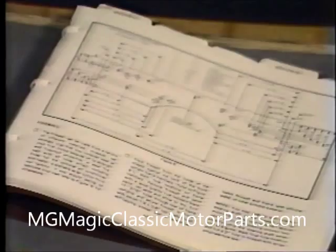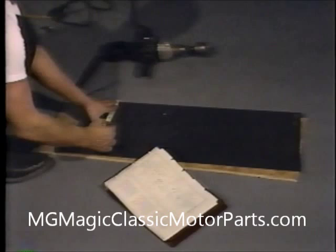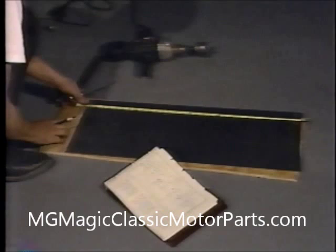When fabricating the firewall, we refer to the instruction manual for proper hole size and location. While a number of different materials can be used, sheet steel is preferable because of its fireproof properties. We use a tape measure and china marker to mark all hole locations. Alternatively, a firewall is available from the factory with all holes pre-punched, including those necessary for air conditioning and heater hoses. If we choose to use the factory firewall, we can block off any undesired openings.